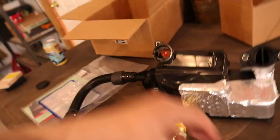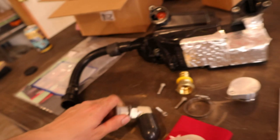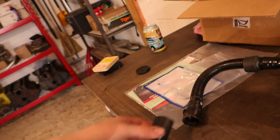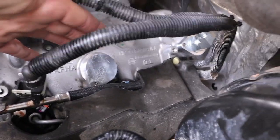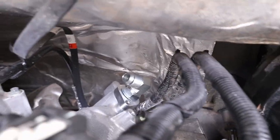Looking at our parts, this one will be our lower block-off — that's replacing the bottom of the old unit. This deal bolts in the back and we'll have our 90-degree fitting. There's this little rubber piece that'll go over there. I got this all installed — the front block-off plate and the rear one are on. I installed the fitting first and it's loose because we'll tighten that afterwards. I tried routing the hose but the options end up going by the exhaust, so let's jump into getting this EGR cooler out.